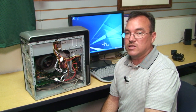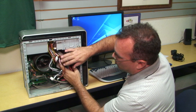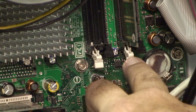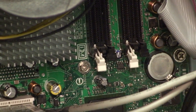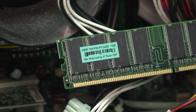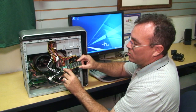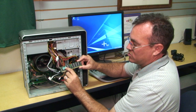You can also look inside your computer at a piece of RAM already installed. This computer already has the case off. The RAM chips are inside and there's a little lever to depress and the RAM just pulls out. If you look on the back or the front, there will be a sticker that tells you what type of RAM this machine takes. You need to look at the style of the RAM, how many pins it has, and how large of a stick it is.